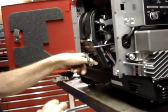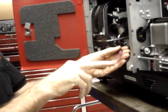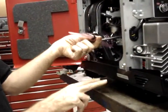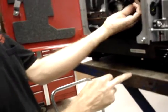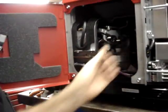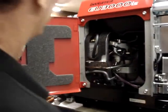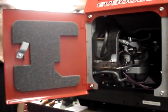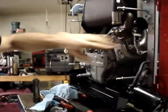Putting more hoses in later on, and we'll be pulling that back out again. You can take the float bowl drain and float bowl vent line and unplug them from these two holes for the time being, and just tuck them up out of the way so that they don't get in your way on this. At this point, you're done back behind this area.